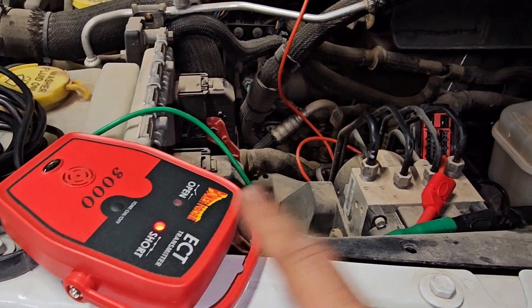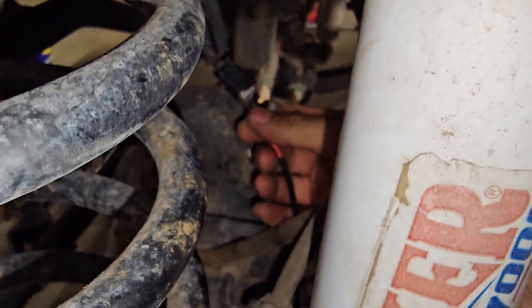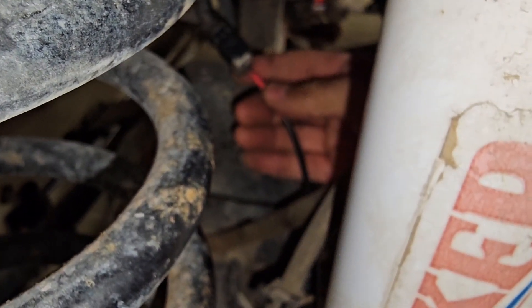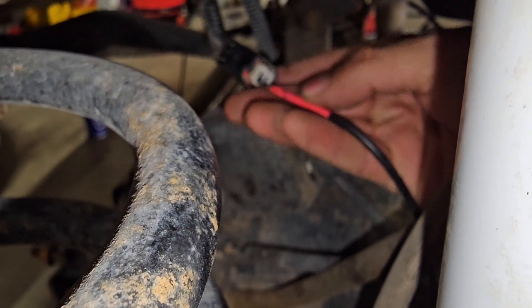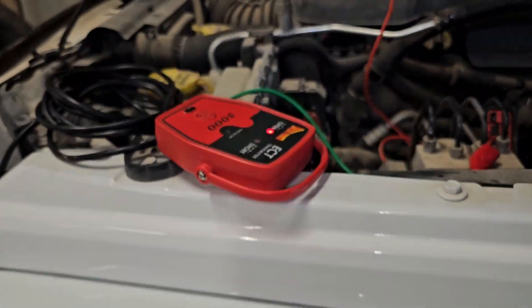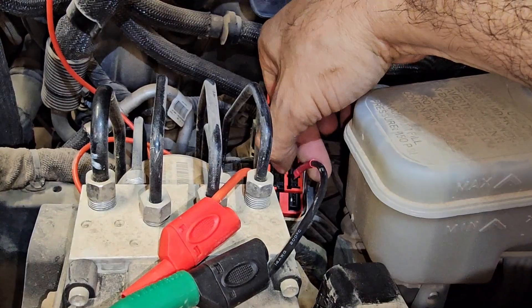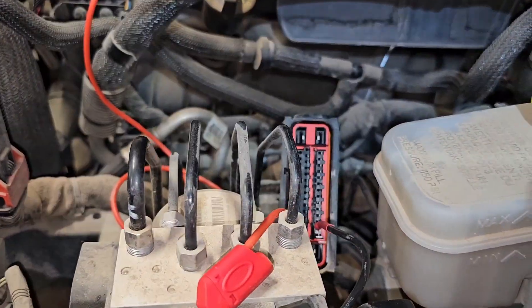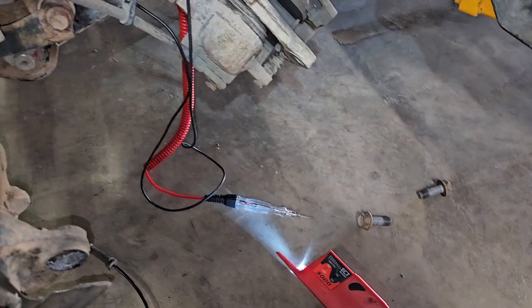What I meant is that it would show short or open. Because both connectors are disconnected, there's nothing in between them — now it shows short because I have it shorted to ground. But when I swap it, it's open. I have it connected on the green one — pin 45 shows open because it's not connected on 45. Let's swap it to 45 and it shows open. It is definitely open.